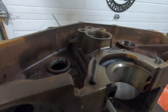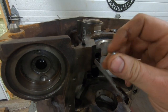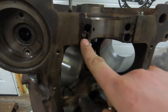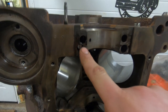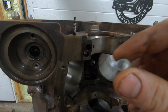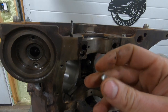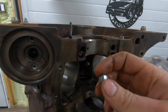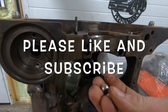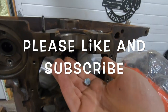Without that plug, the oil goes right up without going anywhere near that oil filter — it just takes the path of least resistance without circulating through the oil filter and goes right up into your engine. So without that little plug, you essentially have no oil filter. Look out for that: if you can see right through this passage beside your main cap, then you know that plug's not in there. If you're getting your block cleaned, make sure that plug is removed before the block is cleaned to prevent debris, but don't forget to put it back in or you'll definitely regret it — your engine will not be happy and your bearings will take a ton of unfiltered oil.